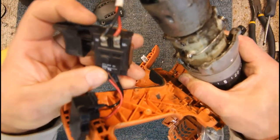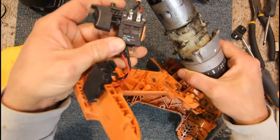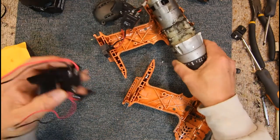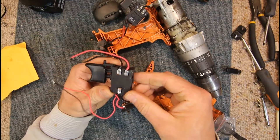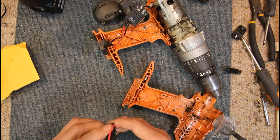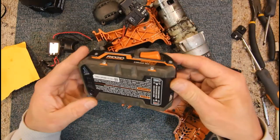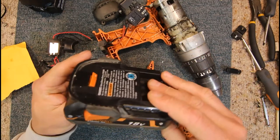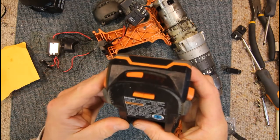And I think that's the part number there, 2711-5516, 25 amp, 24 volt DC. This other one was a slightly lower current, I think, 7.2 to 24 volt DC, yeah, up to 16 amps, which I don't know that this battery, which is a lithium ion, what's our... Where's our current rating or amperage rating?